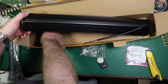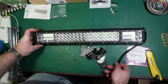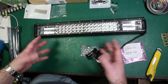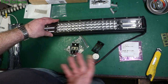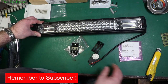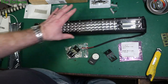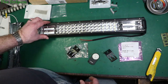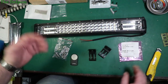It comes with a bolt kit, mounting kit, and two brackets — just like the original one. The first one worked extremely well. I've already got mountings and I'll take the original LED lights off — there are two of those, both 18 watts, so 36 watts in theory. This is actually higher wattage — rated at 260 watts equivalent to halogen though, not really 260 actual watts. When I put the other one in my car it was only drawing five amps. It's a pretty powerful light and I'm looking forward to getting it on there. I do a lot of night driving on unlit country roads in a big vehicle, so you need to see as far as possible.